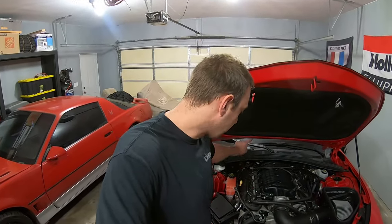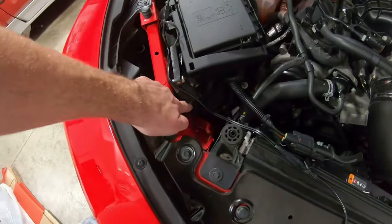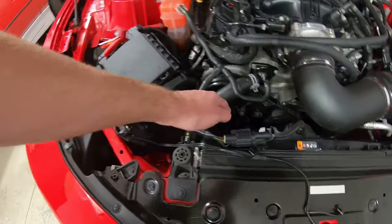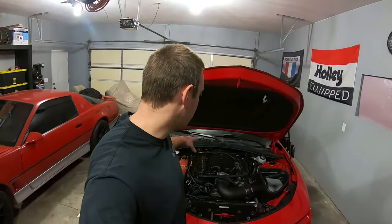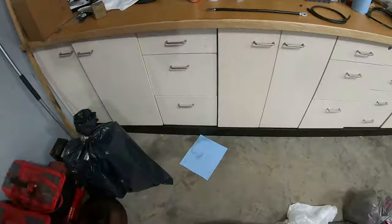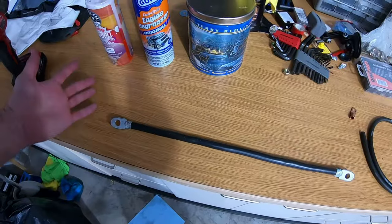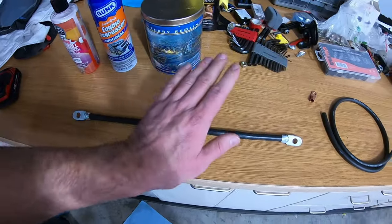Basically you have one ground wire connected to the back of the engine or the starter area that runs up to the front, and this is where a lot of people tie in the extra ground cable — running it from this grounding point to either the tensioner bolt or the bolt on the water pump. I'm going to look for a better spot, maybe underneath the car to the back of the bell housing. There supposedly is an unused grounding stud under there. I picked up a one-gauge cable that's 18 inches long from Tractor Supply Company.